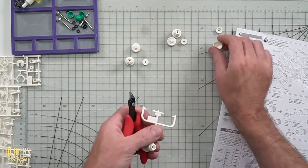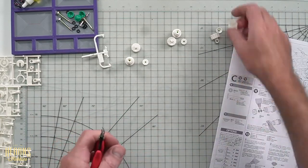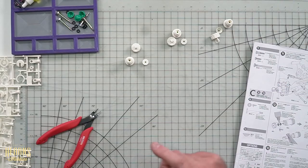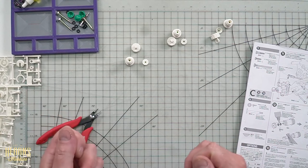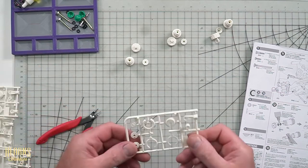I think I'm going to use 30 weight that I've got on hand, and that way at least I know when it comes time — if I want to service it, I've got enough there to rebuild it, and if I want to change the handling characteristics or the tuning of the car, I can either go to a thinner oil or thicker oil and I know my starting point.